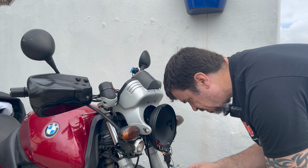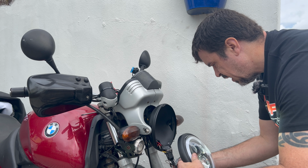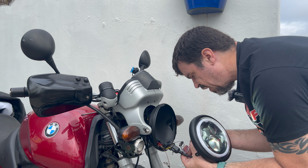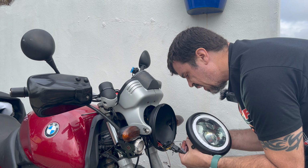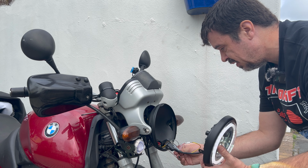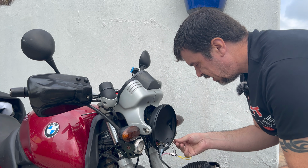Now I'm looking for which one is my side light. It's not that one. Okay. So what I've had to do is build a little cable that goes from red here to the side light here, and that gets my ring light active. And now I've lost function in my side lights here, which I believe is just this circuit needing to be closed. So if I now turn this off, that all works, and that all works. Okay, so I'm just going to connect those two.